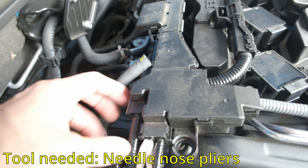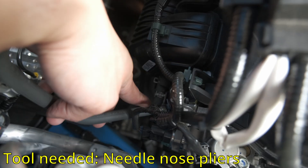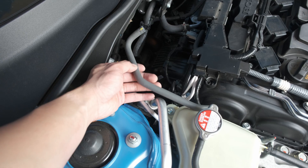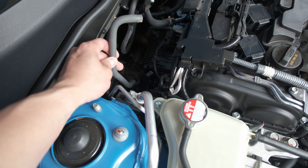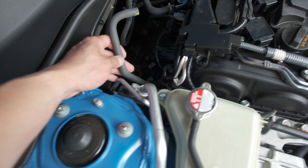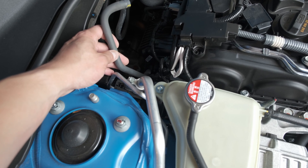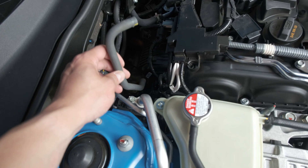After you've taken the PCV hose out, you're going to follow the line and take it out down here as well. We finally got the PCV hose out. The bottom one was really tight, so I just had to wedge something thin and sharp — maybe a flathead screwdriver or a knife — just to give some leverage to pull it straight out.